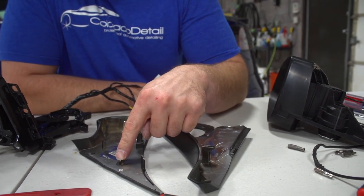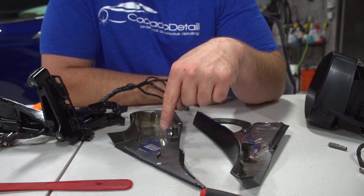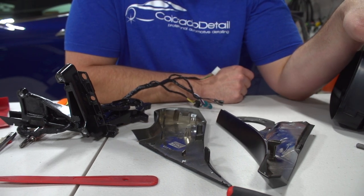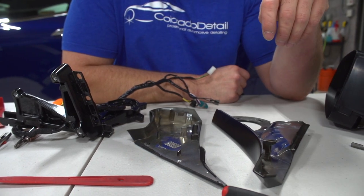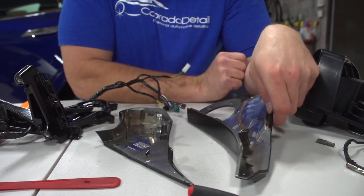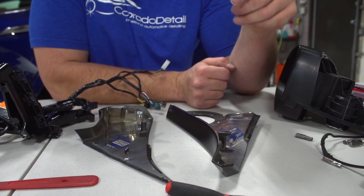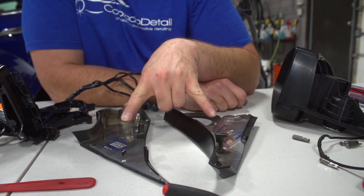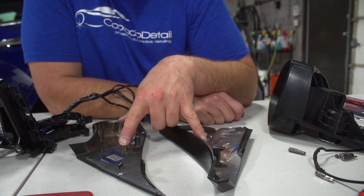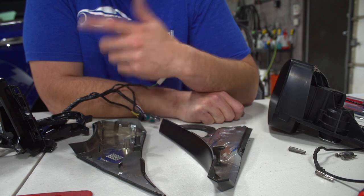You'll notice this one's broken — these ones aren't, but this one is also broken. You need to be very careful when doing this. We replaced this mirror because we actually broke the motor on it. They're not cheap — runs about $300 to $350. As long as these little tabs still hold on if you break them. But if it starts to rattle, you need to replace it. They don't sell these pieces separately, so be very careful. This is one of the very first ones we did, and after this everything seemed to go a lot easier. We now do it quite often.